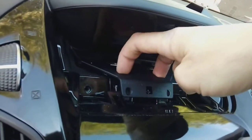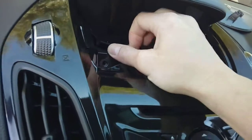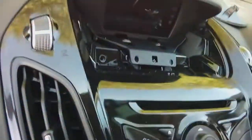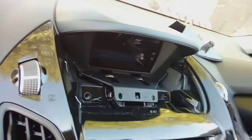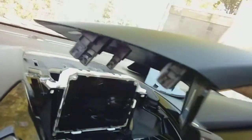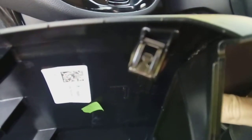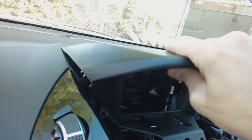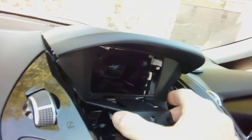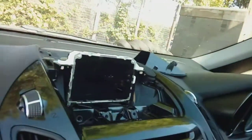To do this, you'll find two slots in the top here — you can just sort of grab it. It is quite well in there on a clip, and you might need two hands. If it doesn't go, you're going to need your plastic leverage tool. That came off in a rush with lots of noise, but don't worry — it's only plastic spring clips. This car has never been in bits before, so it's quite tight. There are quite a lot of clips holding it on, and they're all downward facing, so pull the flap up because it's got a hook piece in the center — pull that up and pop, off it comes. Take that safely out of the way.